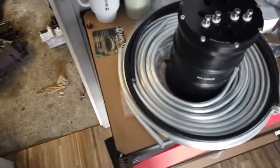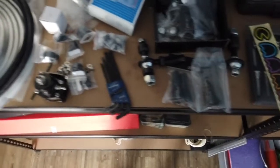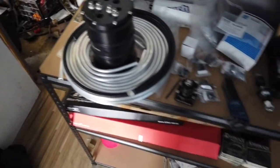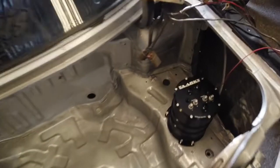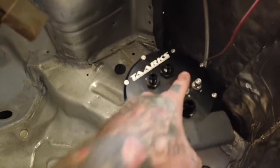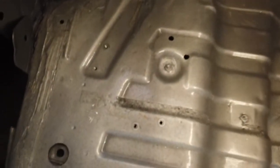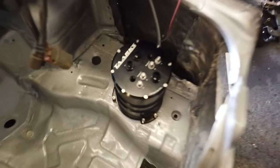Alright, now I'm putting my fuel system together. Just sprayed the boot obviously last night like I showed you. So now we're going to put the fuel system in the car, run the lines, and get that sort of thing done. I've got all the fittings in the fuel system now - I just need to put these last two in for the feeds out of the twin pumps. I've drilled and put riv nuts in the mounting positions, so I'm going to install the last two riv nuts, then bolt it in, and then I can run all my fuel lines.